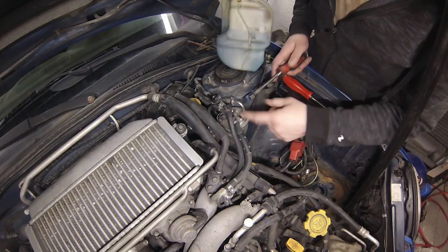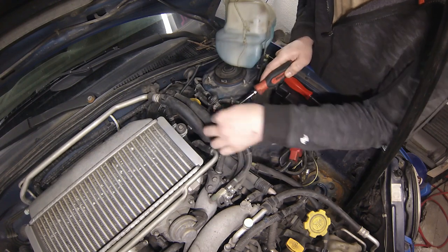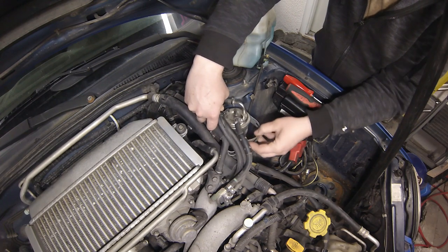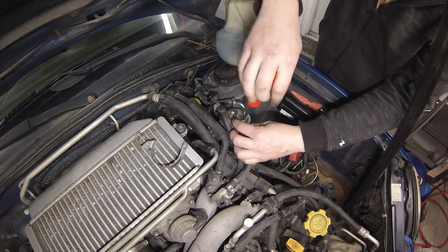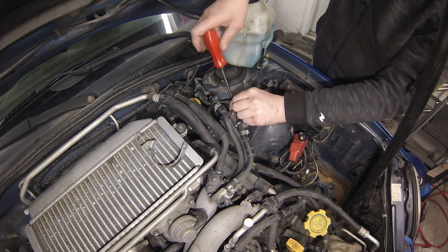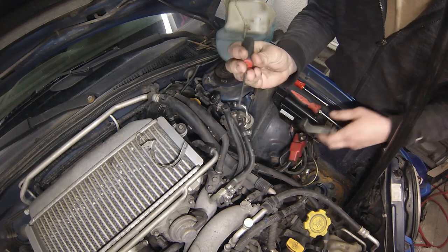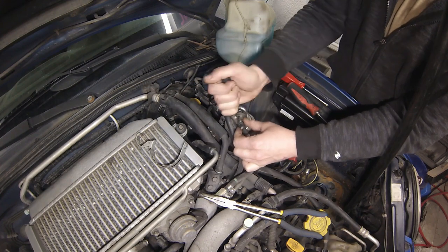So here's that. There's a little clip that actually retains the other hoses — it wraps around one of the steel lines coming off the filter. You can just unsnap that. And then underneath there's a little spring latch that you can let go, and when you pull it around you can take it right off — set it aside. Two stainless steel clamps; be careful of pressure. The lines are usually really tight on them, and in really old cars sometimes you'll end up having to cut that hose and install a new fuel injection hose. So all I'm doing is taking a right-angle pick and getting it between the hose and the steel line and just walking it around to loosen up the hose.